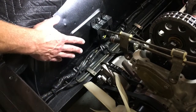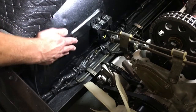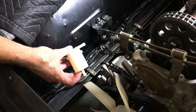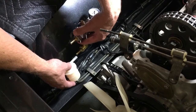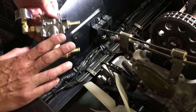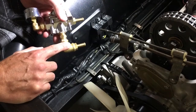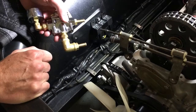The next thing we need to work on is installing a fuel pressure regulator about in this location, and we'll have a fuel filter coming straight off of the fuel line — basically where the stock one is used, except it's going to sit roughly in about this position. We've gone ahead and put some brass fittings onto the fuel pressure regulator, including a gauge. We might down the road change to some AN fittings, but for now, to get this going, we're going to use brass.